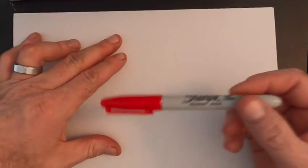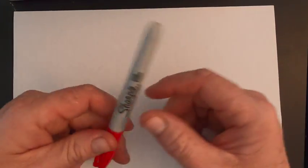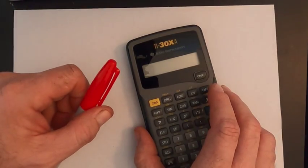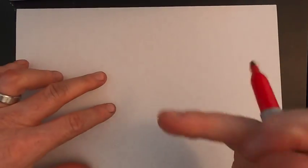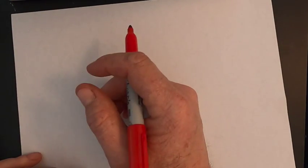All right, here I get to do one of these cool tabletop things. For this, you're gonna need a pen and a calculator and something to write on. All right, so you got your cams out. You've measured your valve clearance. You've measured your shims. You've recorded all those numbers. Now it's time to make sense of that and figure out what our new shims are going to be.